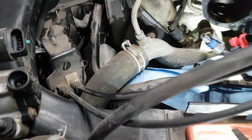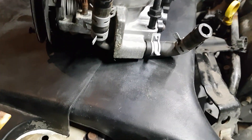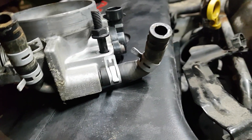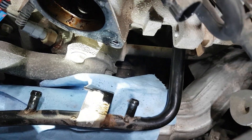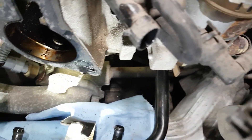Just to give you guys a better look at what we're doing here — so these are the coolant lines on the bottom. It's basically just a cast boss in the bottom of the throttle body with a little pipe going through it, and the warm coolant flows through there and heats up the throttle body. So what we're going to do is take a hose the same size and just loop these two hoses together, and that basically just bypasses the throttle body heater.